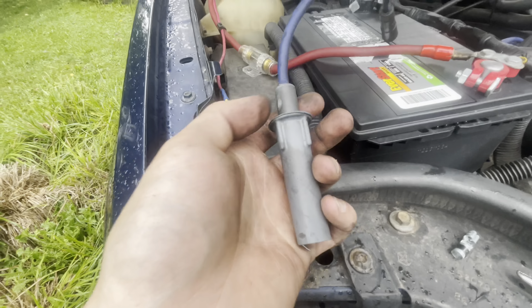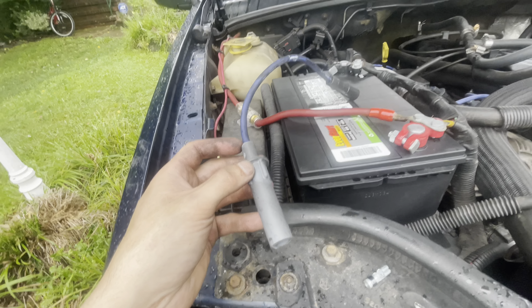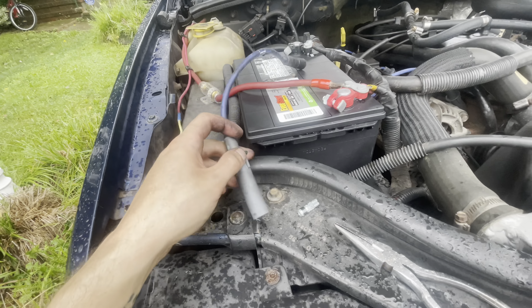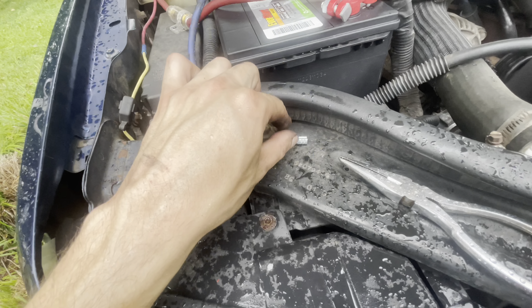So for the boot repair — these straight boots are easy, but curved ones are harder. I actually fixed some on the Mustang before. We're going to pull this wire out and I'll show you what it looks like. Don't lose the connector because we are going to reuse it. Unfortunately NGK decided to glue the wire inside the boot, so I can't fix it — when you try to rip it out, you rip the boot. So now I've got to go buy wires.